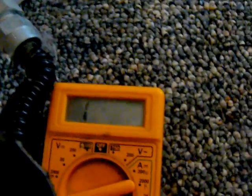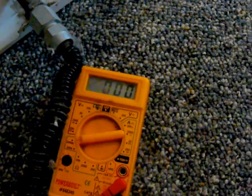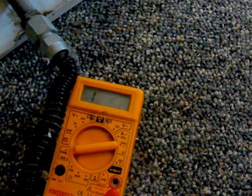And what you're going to want to do is take your ohm meter. You're going to want to turn it on its most sensitive position, and I'll get to that in a minute. Mine was 200K. And what you want to do is take your test probes and put these across each tab. Okay, let's see if you can see this a little bit better like this. Each of the prongs. Okay, look down at your meter. Voila, we have continuity. Take them off. No continuity.